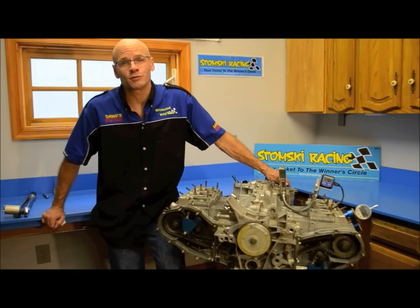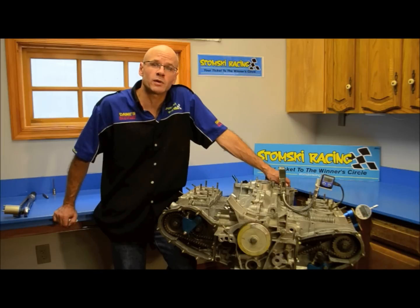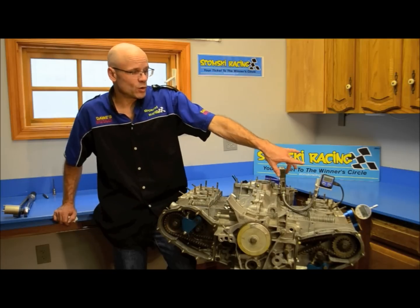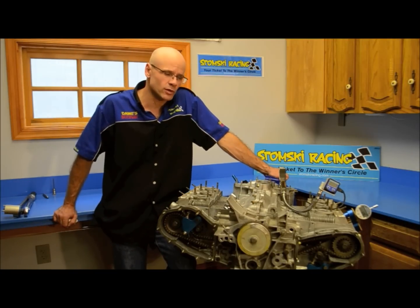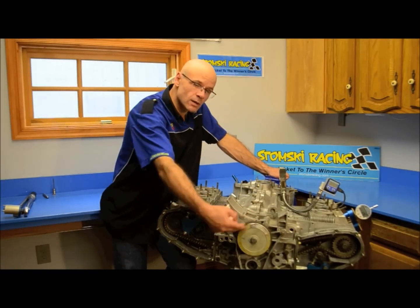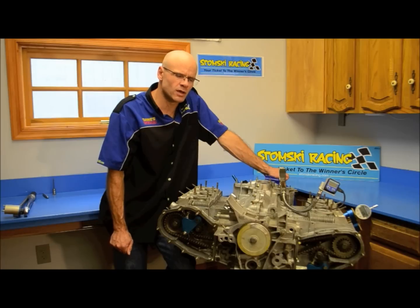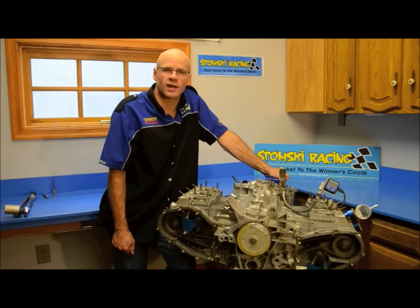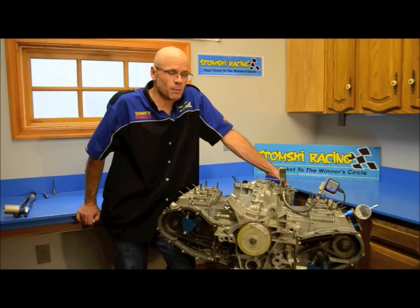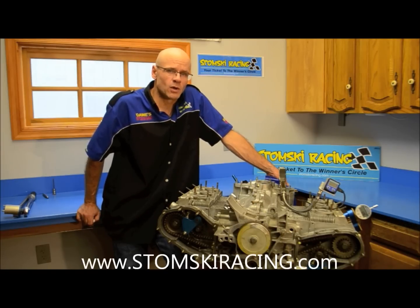So there you have it — that's setting cam timing on the 911 engine using our DigiDix and our cam timing fixture and other tools that make the chore very, very easy, very repeatable, and a very accurate procedure. Those things are very important when it comes to setting up cams on these engines, and certainly when you have a more aggressive cam. The accuracy of one-tenth of one degree repeatability on our DigiDix becomes very, very critical. It makes this a quicker and more accurate process than using pulley marks on the case or a wire-type pointer, because you can actually see the numbers as they come up. Hope that works well for you — appreciate you tuning in, thanks a lot for your time.